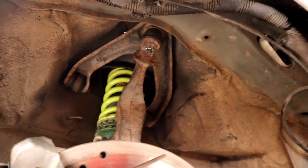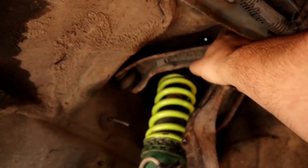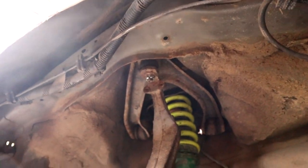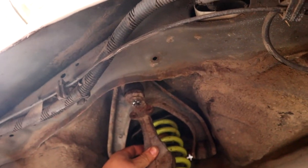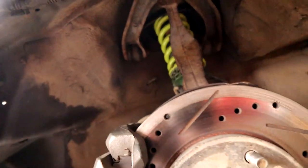So this is what I mean right here — I've got about an inch of play in the control arm without any weight on it. I'm guessing I probably have like a centimeter if I actually put the car on the ground. Essentially we have to do the upper ball joint, tie rod, lower ball joint, axle, brakes — all that comes off.